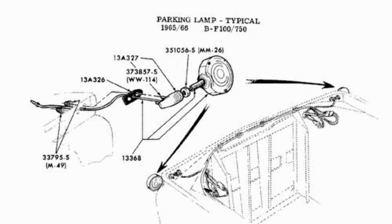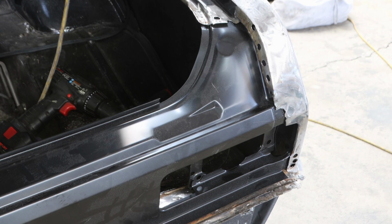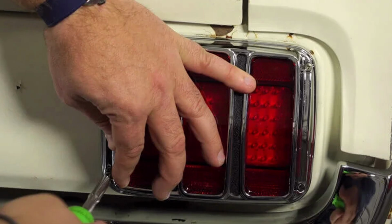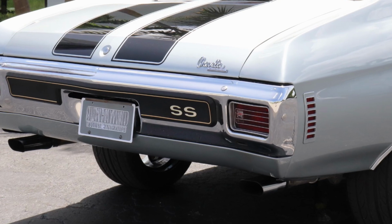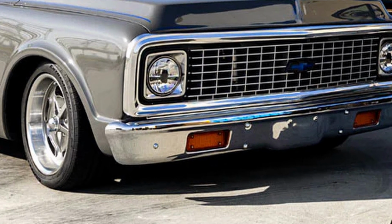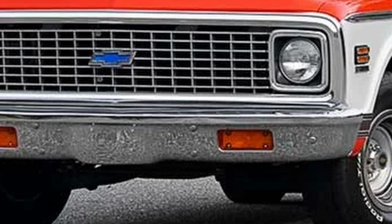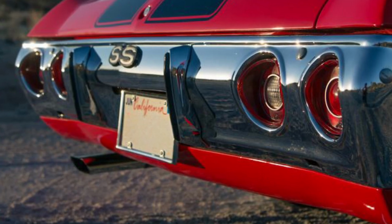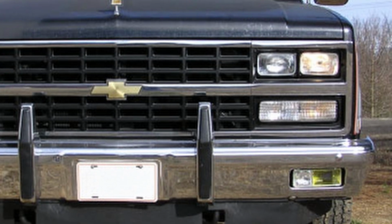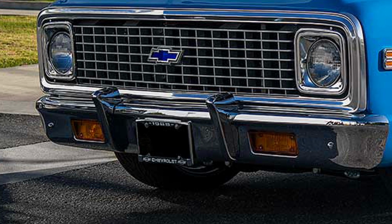When testing electrical items, it is often critical to make sure that all the electrical components involved are fully mounted and have good metal-to-metal contact with other adjacent, well-grounded body panels. In many cases, modern restoration practices and coatings can insulate systems that relied on metal-to-metal contact when the vehicle was originally manufactured. For example, if your car has bumper-mounted turn signals, powder coating the bumper brackets can insulate the light housings from the battery, and this can prevent the turn signals from functioning, or can cause turn signal power feeds to bleed into other circuits.